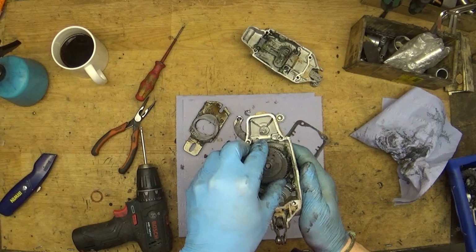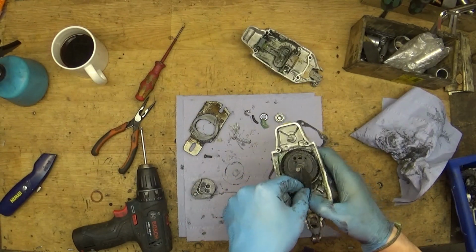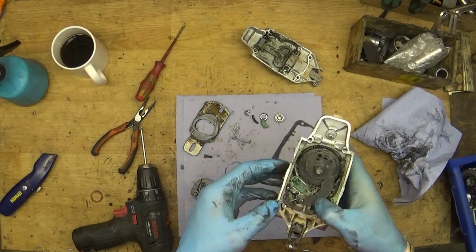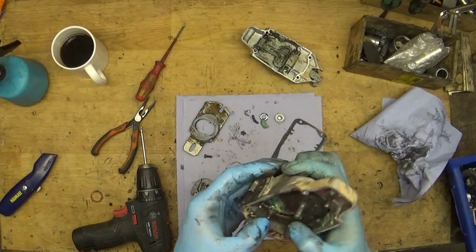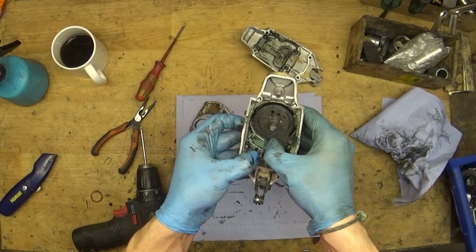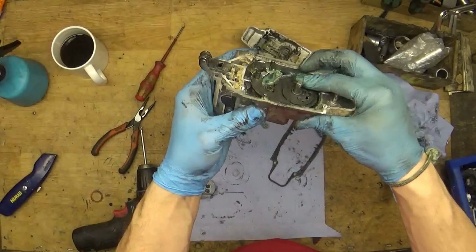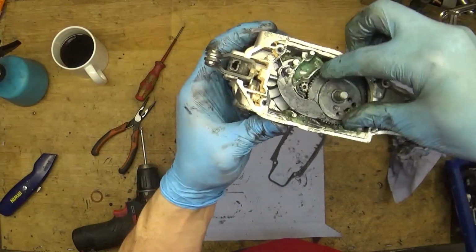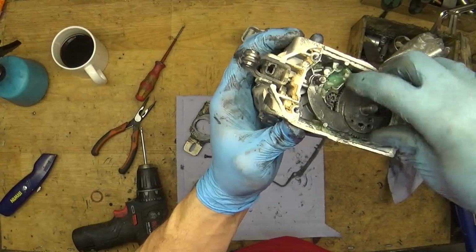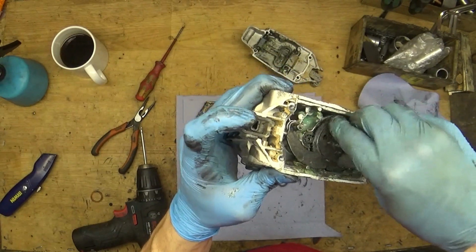And what can we do now? We can try to find the right screws for these ones. Getting the plate back. And yep, it's the pin. Yep, now it's in place. This one is needed for the oscillating move, because when you spin it, you can see that this one pushes the pin up and down. Maybe it's a little hard to see in slow-mo, but it really works that way.